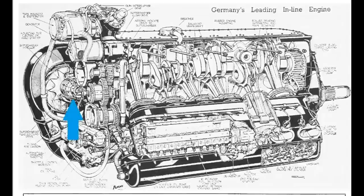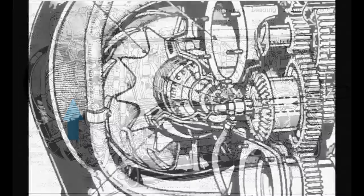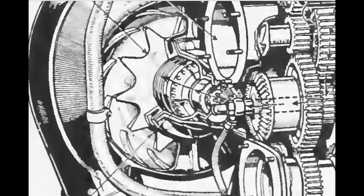I think that reason may have never been known in the English speaking world, and I think it's been lost in the German speaking world, but I don't know that for sure. What's really unique here is the way the supercharger is driven — it's driven by a hydraulic coupling. Technically, it's a Föttinger coupling, invented by somebody named Herman Föttinger. This type of coupling has been used in other applications and principles of it are easily found online — just search for Herman Föttinger. The advantage of this coupling is that it's nearly as efficient as a direct gear drive, but allows for total speed control of the impeller. Thus, there's no need to throttle it at low altitudes and you don't get throttling losses.